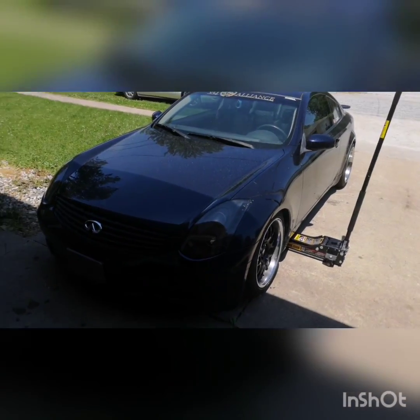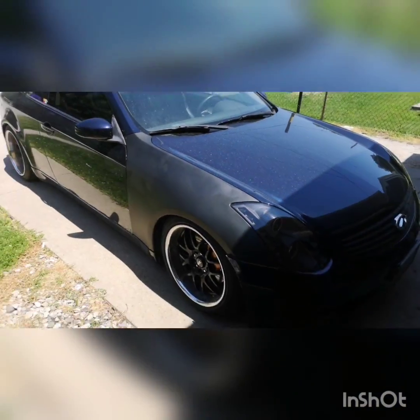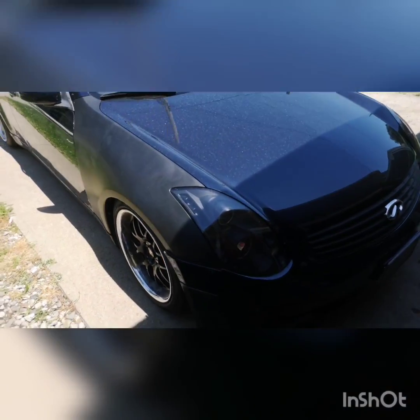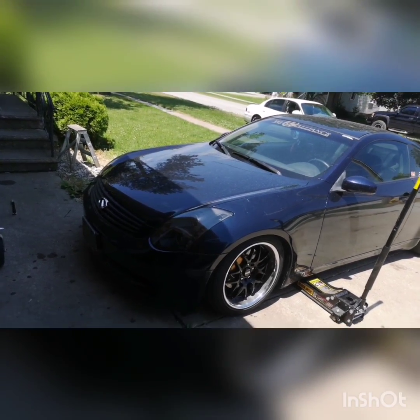Broke Boys Vlog 1, Episode 3. The car is too low and rubbing, so today we're gonna raise it up maybe about three-quarters of an inch — just get the top of the tire and the fender a little further apart. My fenders aren't rolled; this fender's wrapped and it's starting to peel. We're gonna crank these wheels off, jack the car up, and hopefully turn these things up maybe about 10 turns to start, then go from there — bring it back down, see where it sits, take it for a ride, and let the suspension settle.